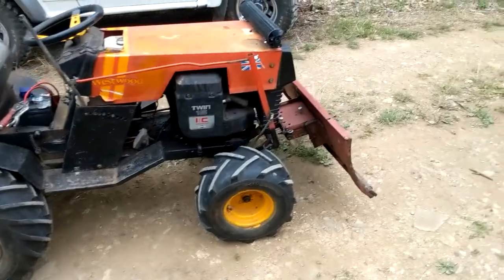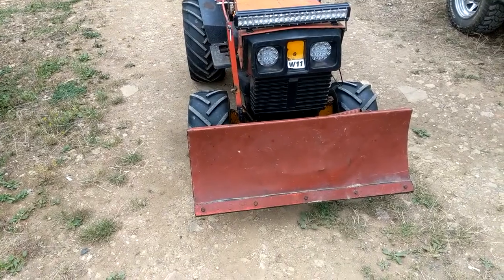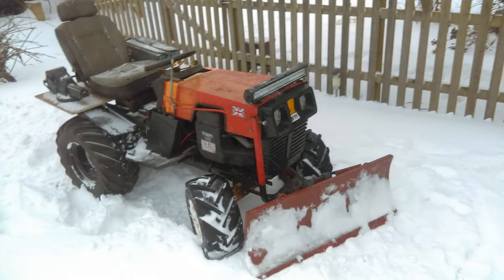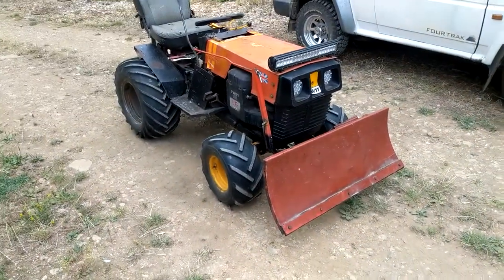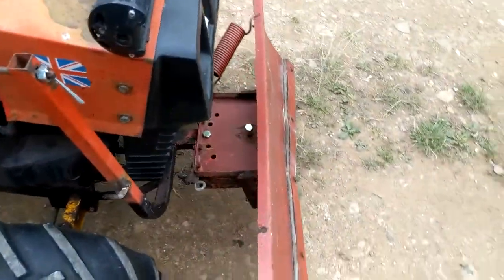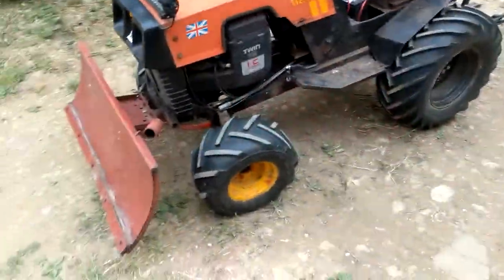And then we've put the snow plow on the front. In the past when I've done snow plowing with it, I found those springs were just way too weak to do any kind of plowing. So I ended up welding it solid so it didn't actually pivot anymore. When I did that, you could do 15-16 miles an hour snow plowing, and it was a lot of fun with this little mower - until you hit a snow drift and then it stopped you dead. And that's why it's slightly bent. You can see the bend in the middle there, and it's a little bit bent on this end. I hit a snow drift and it stopped it dead.